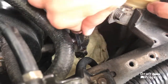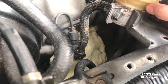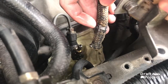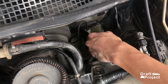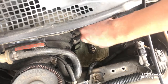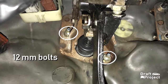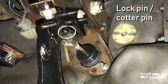Slide the clip upward and detach the hose from the master housing. Be careful not to spill the remaining fluid coming out from the hose onto any panels. Grab your 10mm spanner to loosen the clutch line nut. Next, remove the two bolts that hold the clutch assembly — use a 12mm socket with extension to remove the two nuts.